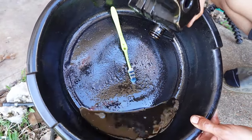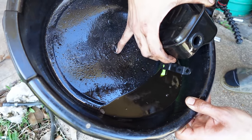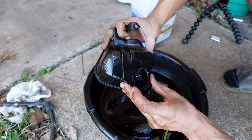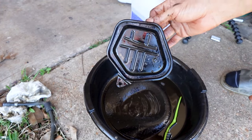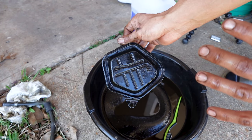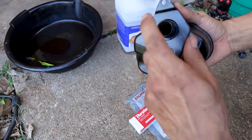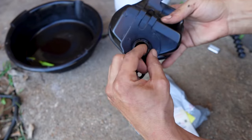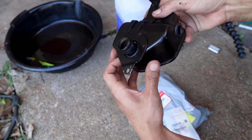I shook it around a few times with the mineral spirits inside. You can see all that crud, all that carbon that's been in there — it's real cakey and flaky. You could do that a couple more times to get it as clean as you can. I'm going to spray some water in here to get some pressure and really clean it out. After that I'm going to let it dry and hit it with a heat gun before installing it, to make sure everything is dry and safe — definitely don't want any chemicals or water mixed into the oil or intake. I used the water hose through both sides and checked by hand how much dirt was coming out. I could see clear metal inside so it's pretty clean.